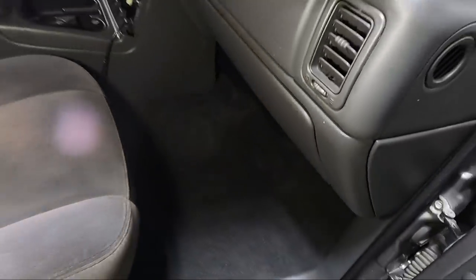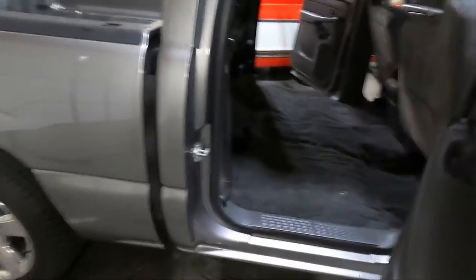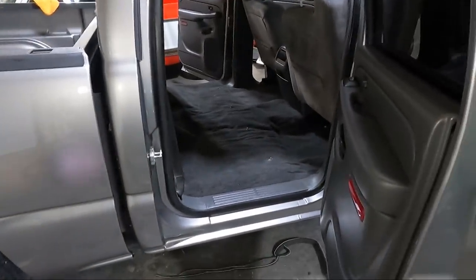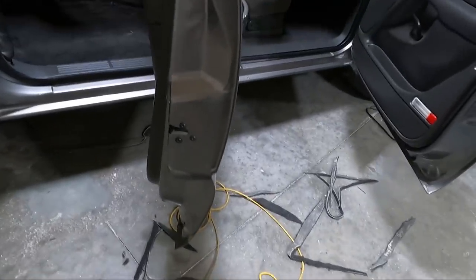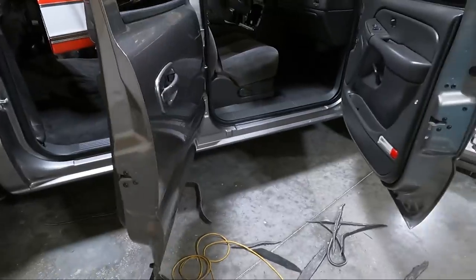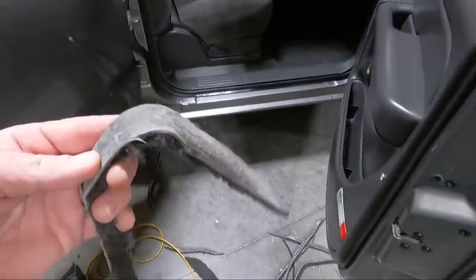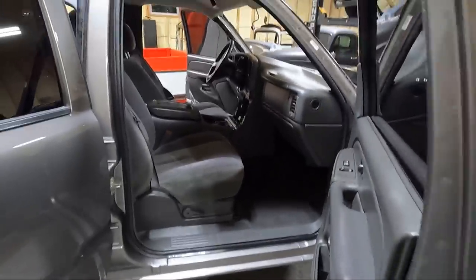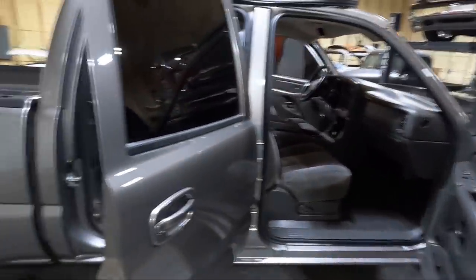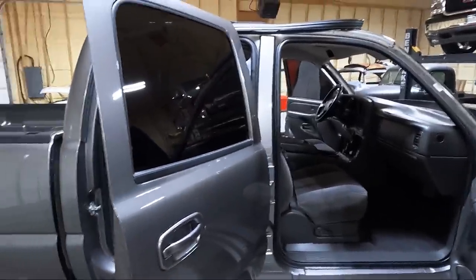So it's laying down really nice, and that's the way it's gonna be once we get some weight on this and it goes through a couple heat cycles outside. It's gonna look really, really nice. But like I said, I also would probably not buy the one with the original backer. Now this backer like this, like I said earlier, while that is the factory style, man, it would make life so much easier just to put two layers of that kill mat in there and then just lay that carpet without. But either way, guys, like I said, I think we are finished for this video.